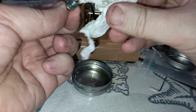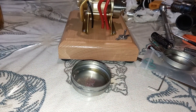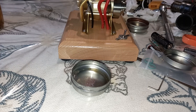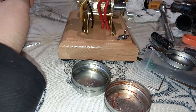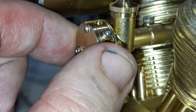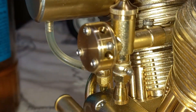So that's probably why it felt loose to start with. I'm going to put a tiny, teeny, tiddly little bit of grease in the thread there so I'm more confident of when this is actually done up. Just a smidge on the thread and we'll pop that back in. It's pretty clear — that's open, closed. Open, closed. Open. So maybe I had the choke on the whole time — no wonder that was fouling up the spark plugs. We'll get that right.